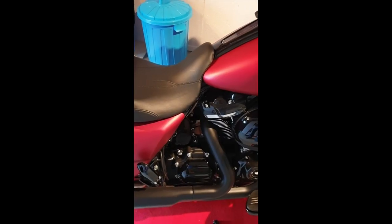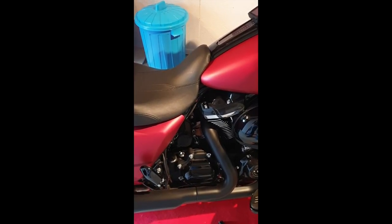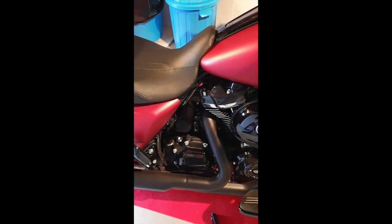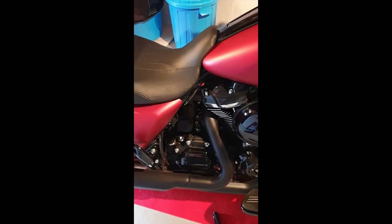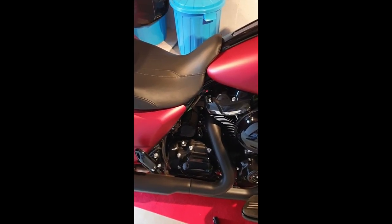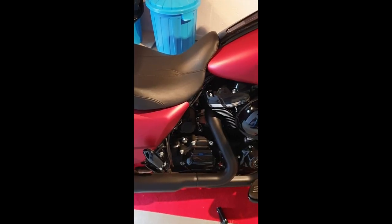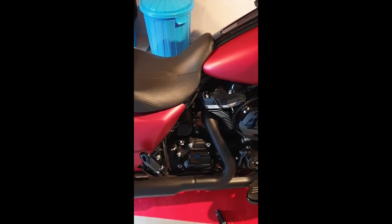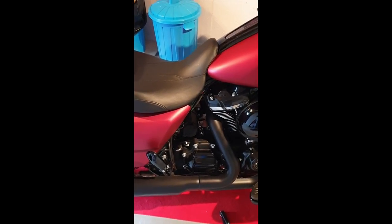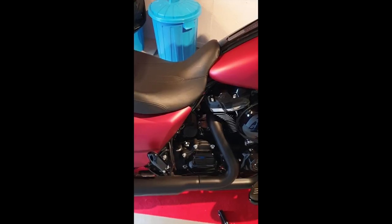This is a new bike and the dealer had a ventilation kit for it, but I think the Greg Williams clutch push rod is the better choice for me. This will most surely void the warranty for the engine — but I hope not. If they want to inspect the rod, they're going to have to dismantle it to see it. This is the oil transfer problem that the Harley-Davidson Milwaukee 8 engine has on some of the touring models. If you bought a new bike, be sure to check it out — it's never good to run low oil in the transmission and too much oil on the primary side. Thank you for watching, see you soon. Happy riding!